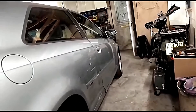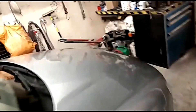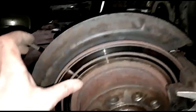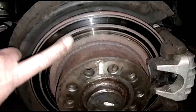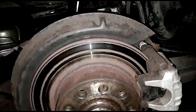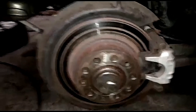So that'll be the brake lines done and the bushes. It needs a number plate light sorting — there's no power to any of them, so I don't know whether that's wiring or just bulbs. The biggest jobs really are them bushes. There's also a link arm at the front for the suspension — two bolts on there. Pads and discs at the front — I've got 280 mil discs which might do for the Audi if they're 280 mil, we shall see. It also needs a rear left wheel hub. Anyway, I'll just get through MOT first.